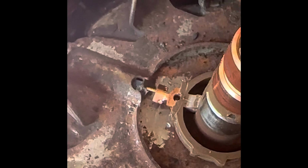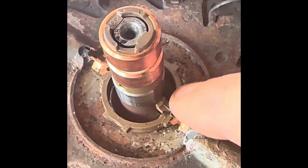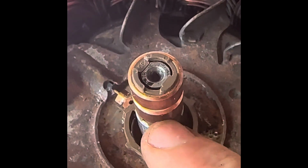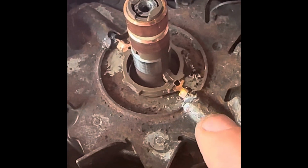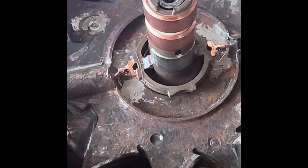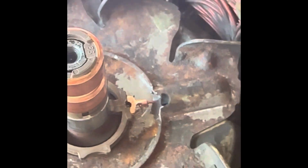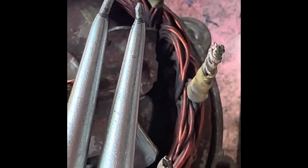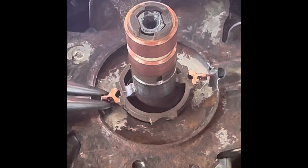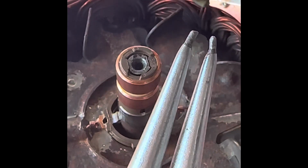Now I might put some solder on there, but they weren't soldered to start with, so let me see. So I'm just going to get some pliers and crimp them up, and then we'll do a continuity test here to make sure that the coil and everything, there's no problems with that. Okay, look, I've crimped them up there and there. I've actually found these pliers were brilliant. These are actually circlip pliers, but because they're curved, they're brilliant to go around there and crimp up underneath.